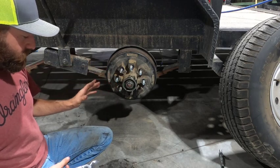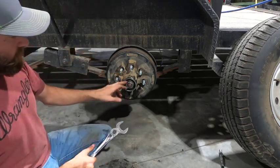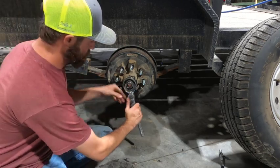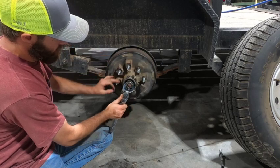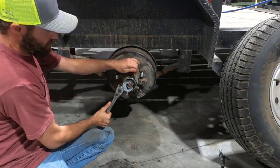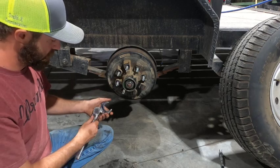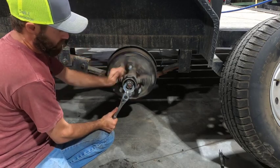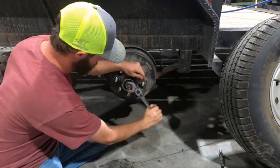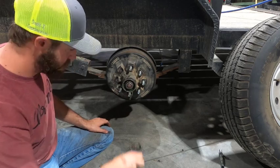I've got everything put back together. I'm going to snug it. My setup is an inch-and-a-half crow's foot on a half-inch drive ratchet - it's actually a 38 millimeter. I'd rather have a socket so I could tighten it by hand, but what you want to do is go the opposite direction and snug it up. We're setting preload. That's pretty tight - it'll get really, really hot going down the road, so that's not all we want. I'm going to go a little more, then back it off and loosen it all the way, then tighten it by hand.